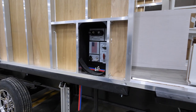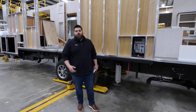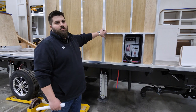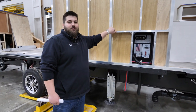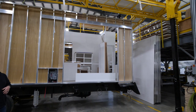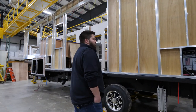To compare this to a laminated wall: a laminated wall is welded, and welds are great, but when you weld some of these thinner gauges of aluminum, you can overheat the aluminum. You don't worry about the weld cracking — you worry about the aluminum next to the weld cracking. Going down the road you're going to have movement, and with that stiff weld there's an opportunity to crack the aluminum next to it. These brackets give it a little bit of movement. Anyone who's towed a trailer knows you get movement hitting bumps and going crosswinds at 65 mph. We feel this is a superior construction — when you look at traditionally premier high-end motorhomes and fifth wheels, it's hung wall construction, not welded.